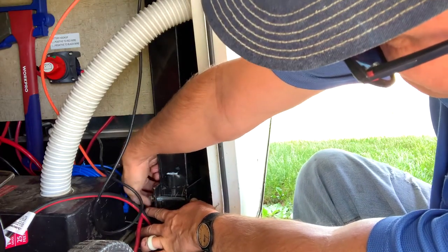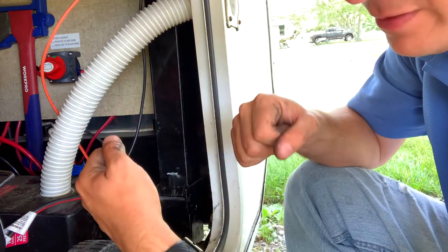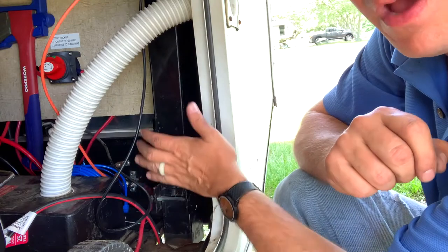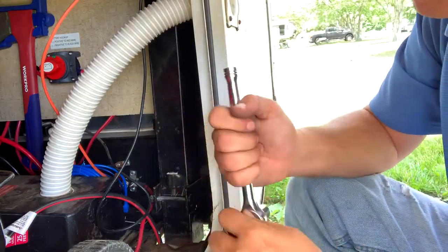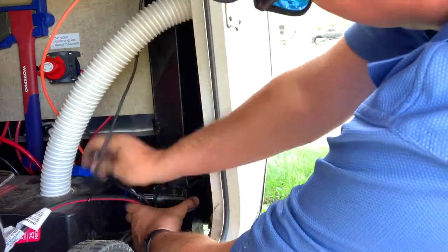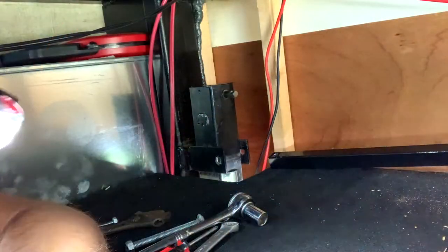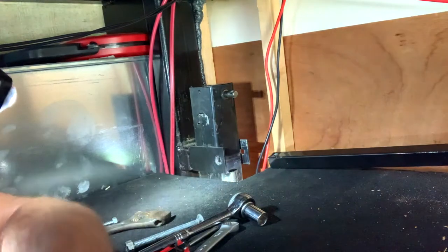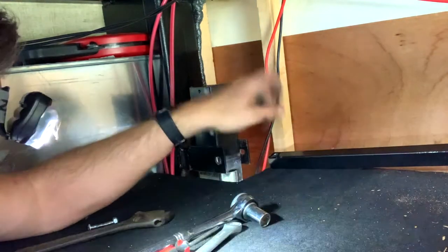The final thing is just to put these bolts through down there so that it holds it in place. Remember, you're not looking for these to necessarily be holding anything — really like the grip strength from the sides, it's not squishing this in and holding. Everything's sitting on those welded tabs in the back; this is just holding everything back. On the inside, this is by far the most annoying part because you've got to squeeze yourself up in here. Basically the same thing: seat it back up in there, put the bolt through, and then attach the drop wire.